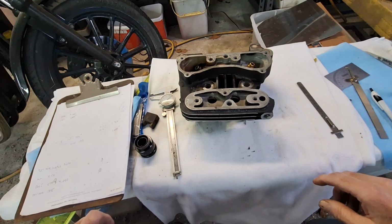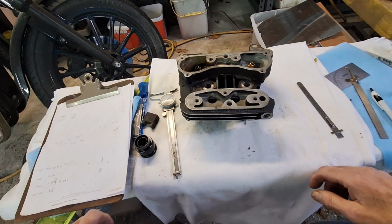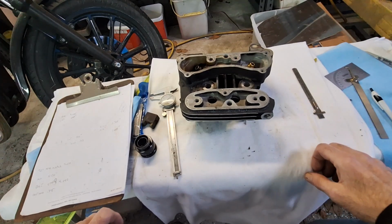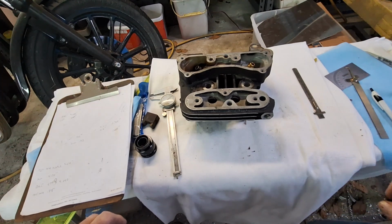In the '70s, it started taking lead out of stuff, and the lead is what protected your valves and your valve seats. Lead was there to give it a little cushion to protect mating surfaces. Other than that, lead did nothing, just protected the top end. That's all lead did. They didn't start using lead in fuel until 1937, I think it was, the first year they started using tetraethyl lead. But that's neither here nor there.